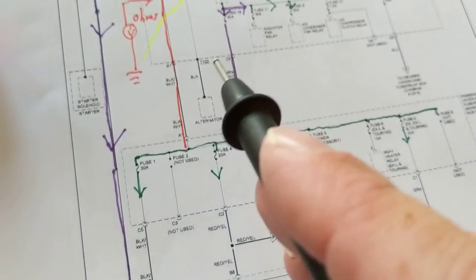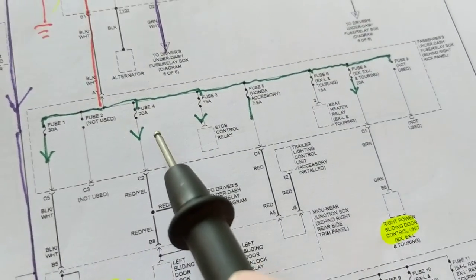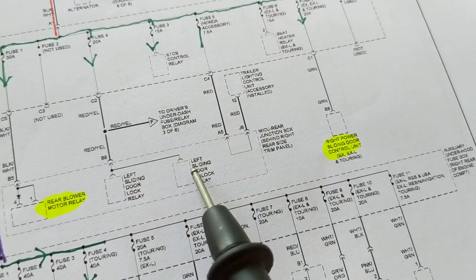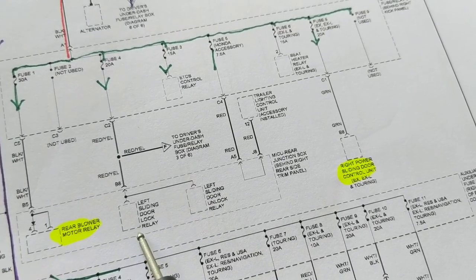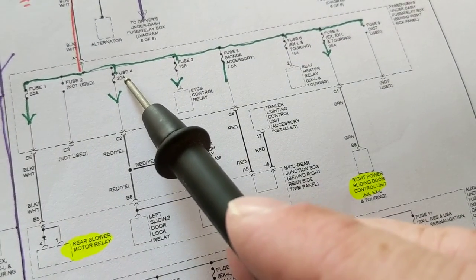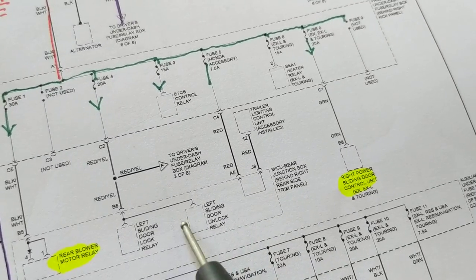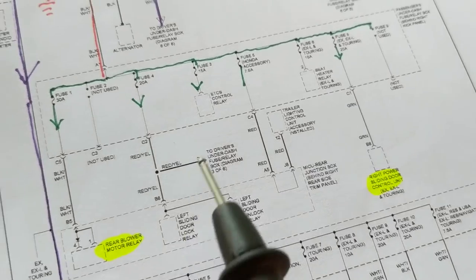However, to make sure that nothing else is connected to these, let's say over here, I pulled out this fuse. This is the culprit. That means there's one circuit, 2 circuits. There's 2 circuits over here. One of them has to be shorted to ground. I don't know which one it is, right? When I opened up this fuse, it just told me that 2 of these, right, are a problem, right?